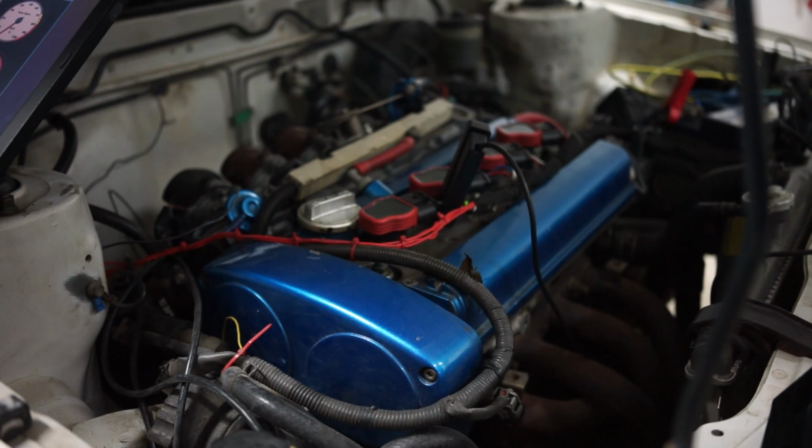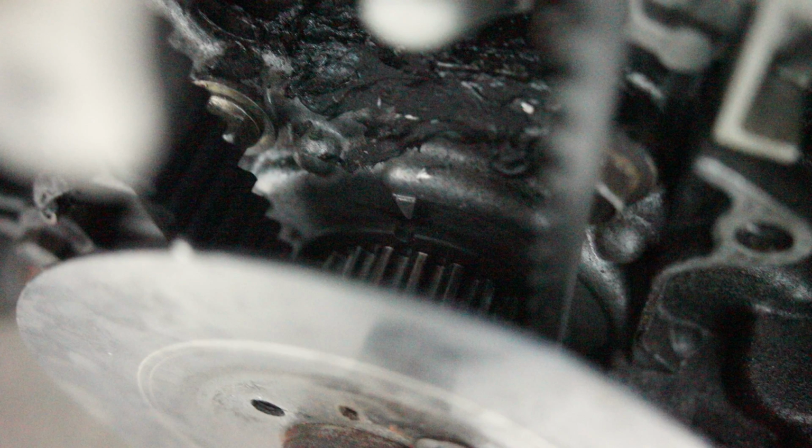If you do not have any markings on your pulley, pull out one of your spark plugs or look at the TDC markings on your timing belt and put cylinder 1 at top dead center. And then put a marking onto your crank pulley and somewhere on the same spot on the plastics of your timing belt cover. Then you can set the fixed timing that I just set to 10 degrees, set that to 0, and then just aim for that marking you set while the engine is running.